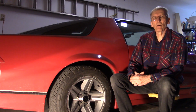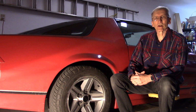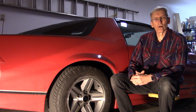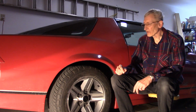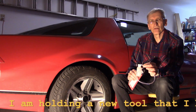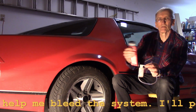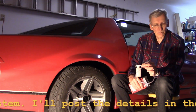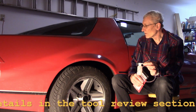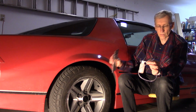I didn't show everything on video because I was running short of time and daylight, and even though I'm working in a garage, I wanted to get the car out on the road before dark and get the brakes adjusted in and get a test run on it. So I did go through and bled the system. As I say, I have it on the road. The brakes are about probably 80–90% adjusted. In order to make the self-adjusters work, you need to back up and brake and then go forward and brake and work the adjuster mechanisms. But the pedals come up and seems pretty good, so I've been out just burnishing them in a little bit, making some moderate stops to get the linings broken in.